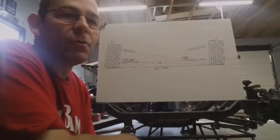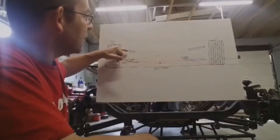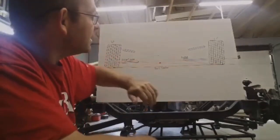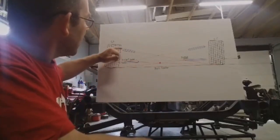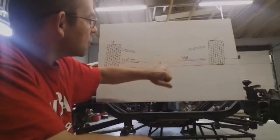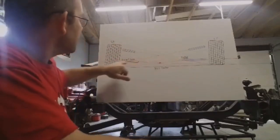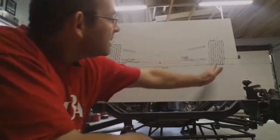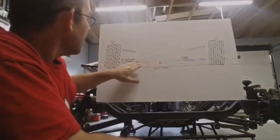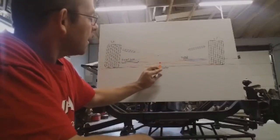What we have here is a diagram of the front end roll center — trying to simplify it so you understand it. We have the right front tire, left front tire, right front upper, left front upper, left front lower, and right front lower. With your race car sitting on the ground at ride height, tire pressures set, caster and camber set, you find measurements from the ground to the center of the ball joints on the uppers and lowers, then measure to the inner mounting points of the control arms. Draw your diagonal lines to come up with your instant centers — left front and right front. Then find the center of the tire patch and run a line from the left front tire patch to the right front instant center, and vice versa. Where those lines intersect is your roll center.